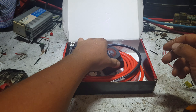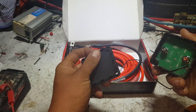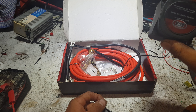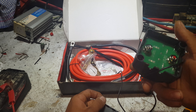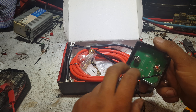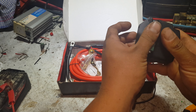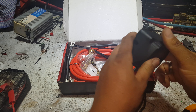Something I thought of just after having a look at how simple this is — you actually mount this back panel, it just snaps on and off, and a couple of screws go right through. There's no reason that in an emergency you couldn't bridge these two terminals together with a bit of steel or whatever. By bridging those two together you'll be connecting the rear battery straight to the front vehicle battery, and you can quite easily fire it up.